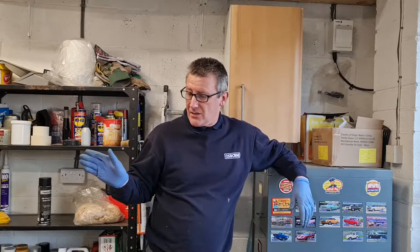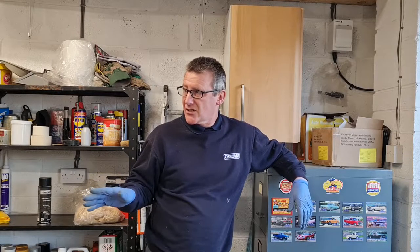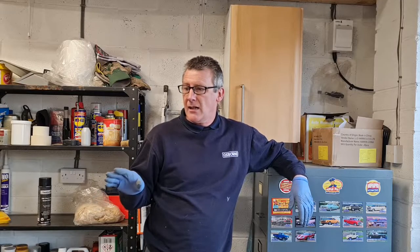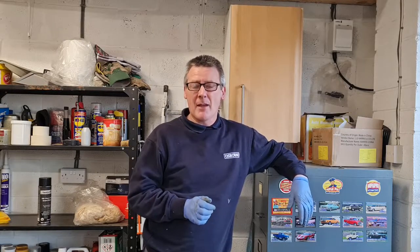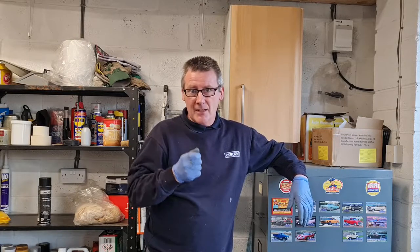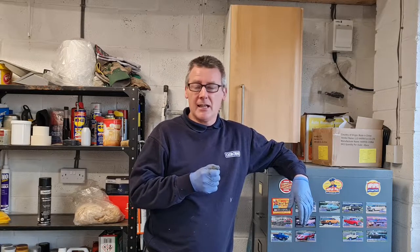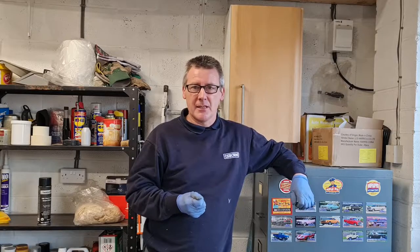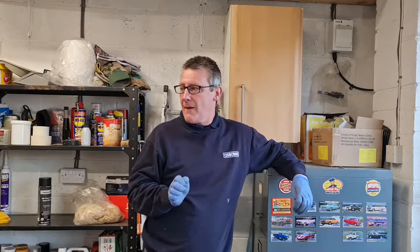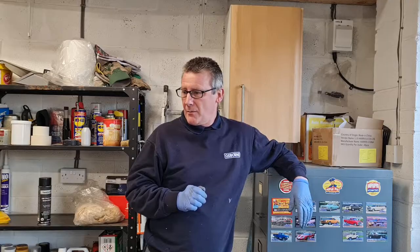Well, at least we got that lot cleared out. I mean, she's a 2006, 2007 Mercedes C-Class. So, I mean, the jets are like 15 years old. So there's about 15 years worth of grime up there. Yeah, just gave it another little clean out with the pins. And yeah, I ran the engine so there's a little bit more strength in the jet washer motor as well. That's fine. I'm happy with that.